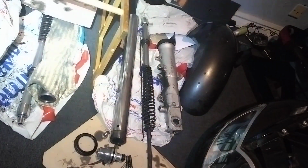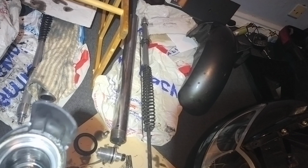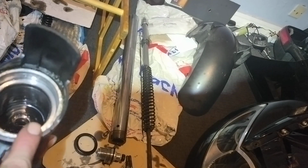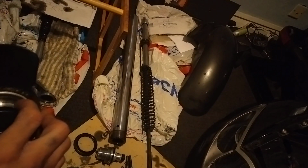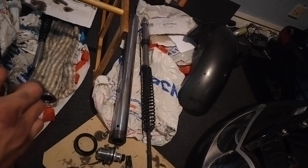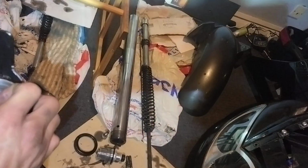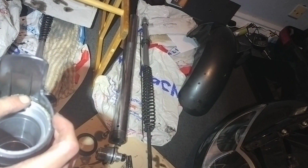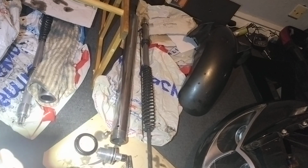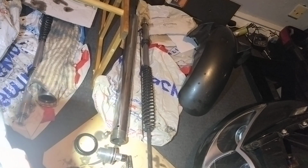And if you do mark the top of it removing it, if you're able to mark any bits around here, around the top, just take a little bit of Scotch-Brite, dip it in some fork oil and just go around the edge of it, smoothing it back off. But we've not done too bad there. We've not marked it really badly. The same down here. We've got that out really well.